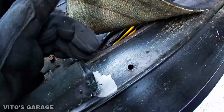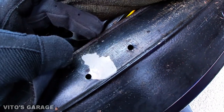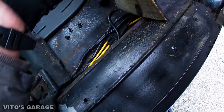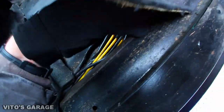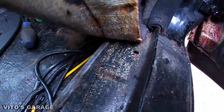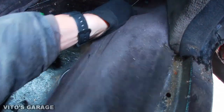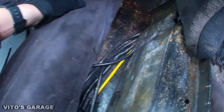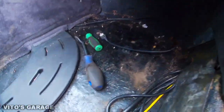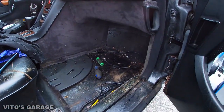When you remove the carpet, some paint may come off, which is normal. You will just have to paint this area afterwards — don't leave it like that because it will start rusting. And you just kind of peel, keep peeling it until you remove it completely. You want to check all this area for the metal and everything — check all that.